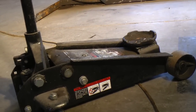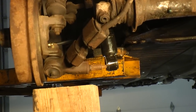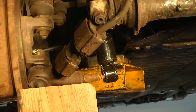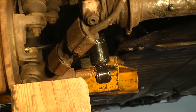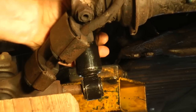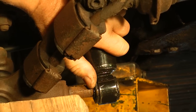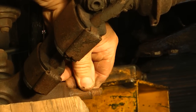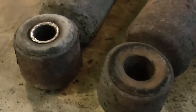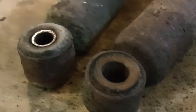As you can see, the rubber is sandwiched, and at this point we've got a shock. If the shaft from where the ball joint is is hanging lower than the shock, you can use a jack and jack it upwards so it lines up with the hole on the bottom of the shock. Now here's a common problem — you see this bushing on the shaft? That's the old bushing off the old shock — it got torn right out when we were removing it. One has the bushing, the other doesn't.